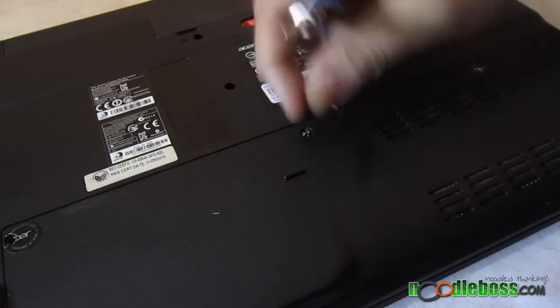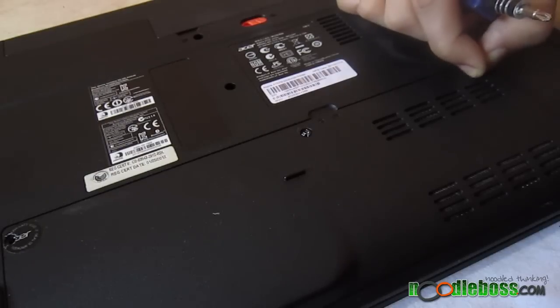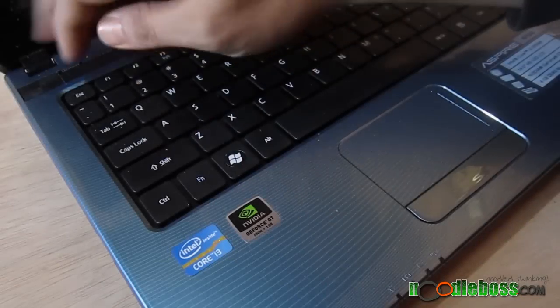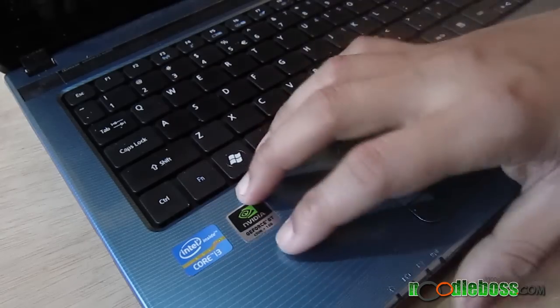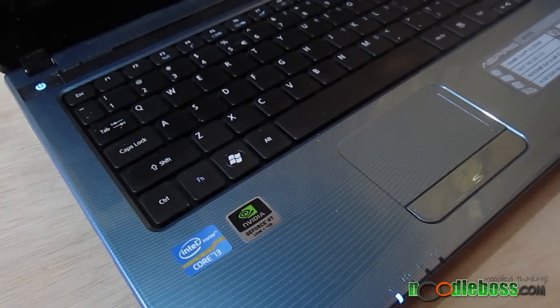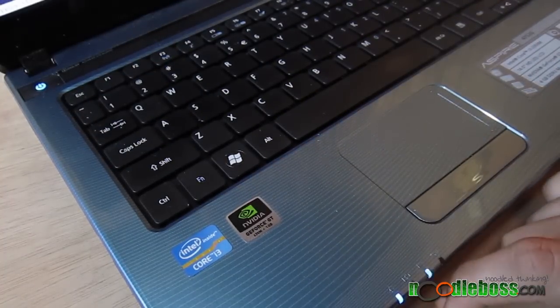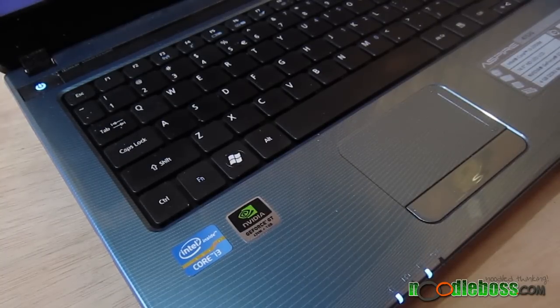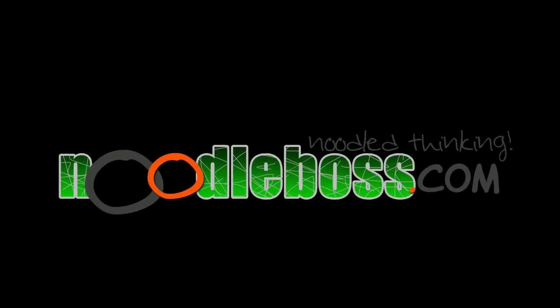Screw it back so you can completely flip over your computer. Next, you have to test your computer to see if it's still booting up. Press power, check the lights, and check if there are any error messages on your monitor. I'm seeing hard drive activity on the LED lights so everything looks okay. If you hear any error messages, pull back your memory card and put it back again — there may be a problem with the contact on the metal plates.